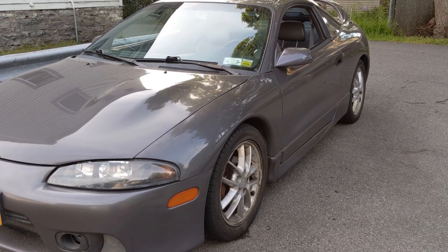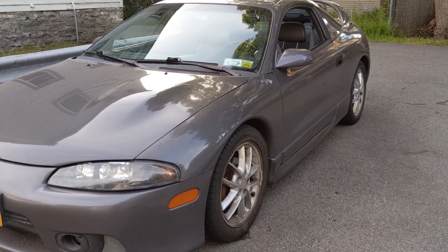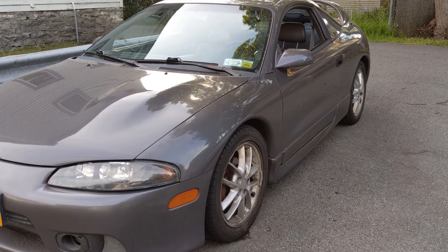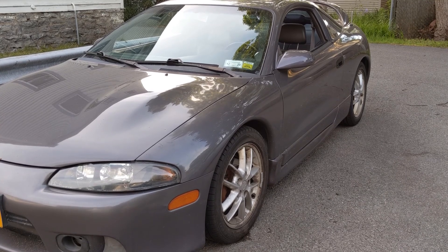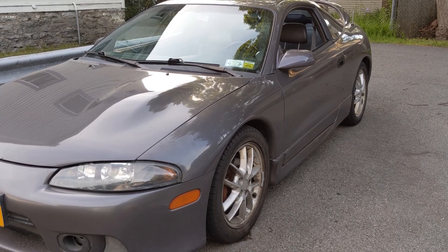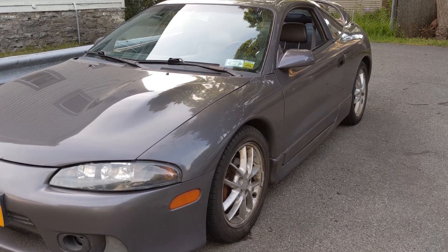That's it for today's video — how to change an alternator. It's kind of an interesting task on a 2g DSM. I didn't think it was going to be as difficult. As I showed you, popping out your driver's side radiator fan and slightly bending your dipstick about a quarter to a half inch out of the way gave me enough space to just slide it out the top. Hopefully this helps somebody out. If you like this video make sure to give it a thumbs up, throw a comment below with questions or ideas, and don't forget to subscribe. I got a package from the DSM community on Facebook — we'll see you tomorrow!